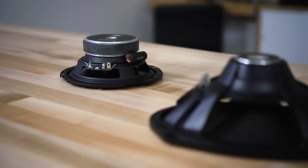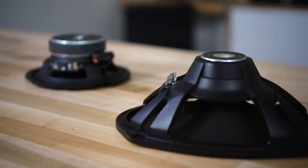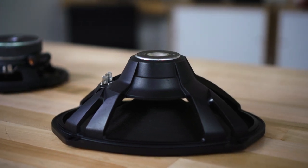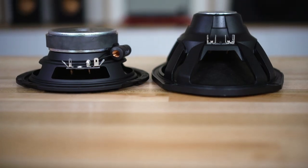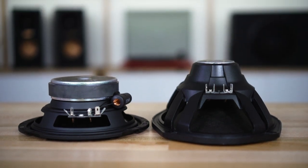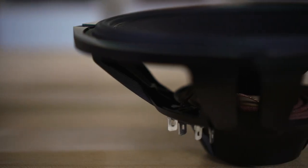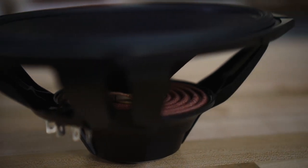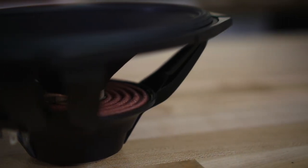If you look at the back of these speakers, you'll notice that the magnet looks a little different than it does on other speakers. It's not a big huge thing hanging on the back of the speaker — it is small, and it's not installed the same way most magnets are. Most of them go around the outside of the voice coil, but this magnet is mounted with a direct drive approach, meaning it's installed inside the voice coil, allowing it to do its job of controlling voice coil movement significantly better, while also making the speaker easier to fit into your car.